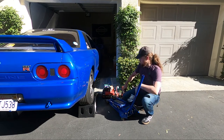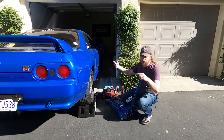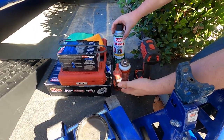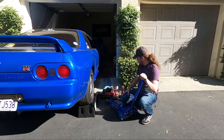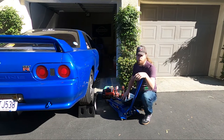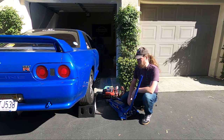You're going to need the replacement parts. We've got rotors and pads here for the rear end, and a set inside for the front — we are doing all fours. We've got a brake caliper compression kit to push the piston in. You'll need some chemicals: brake cleaner to get the coating off the new rotor so it works right, some anti-seize, and some brake quiet to help with noise. You'll also need something to hold the caliper up while working — a rod, zip tie, or bungee cord — and an impact wrench to get everything off.